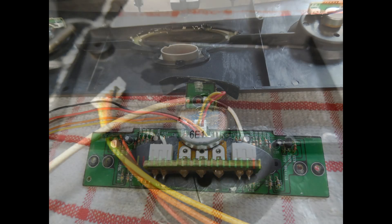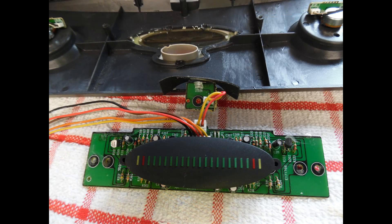I'm also showing the LED board — the indicator for signal strength coming in, and the top blue LED. It's dead easy to remove from the plastic bezel. If you find this filter sort of pushed in, don't try to work from the rear without removing it — it'll take you next to no time, probably four or five minutes just to remove the bezel and work on it easily, rather than struggling from the back. Just be careful when you refit these plastic clips that clip top and bottom, as over time such plastics do become brittle — you don't want to snap any of them off.